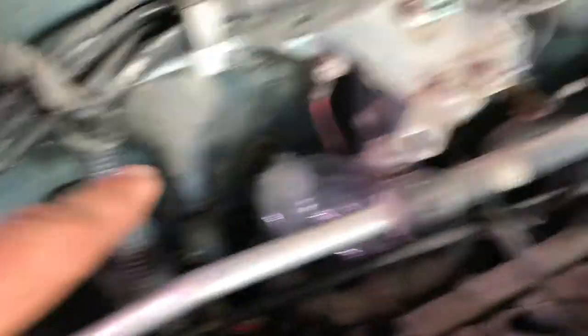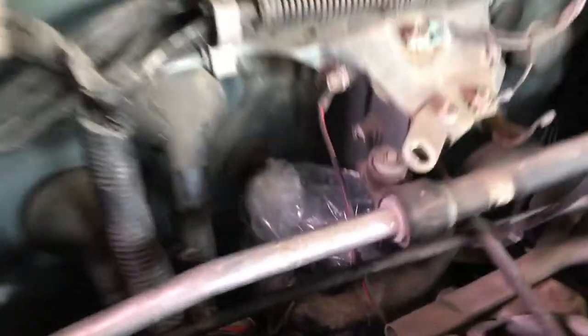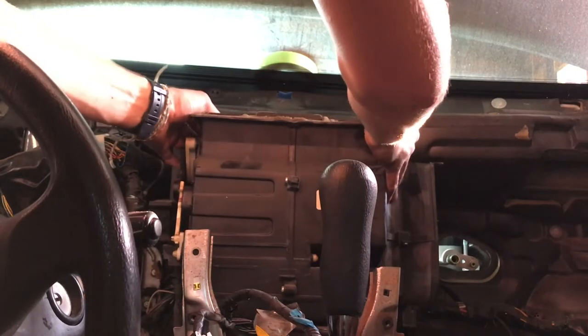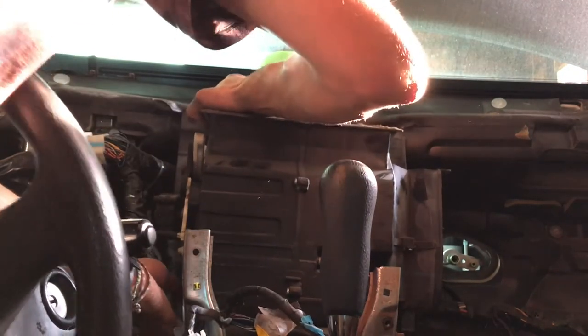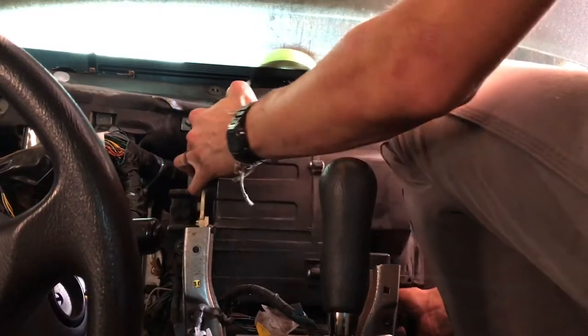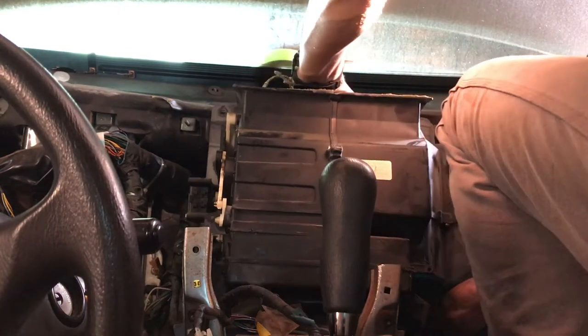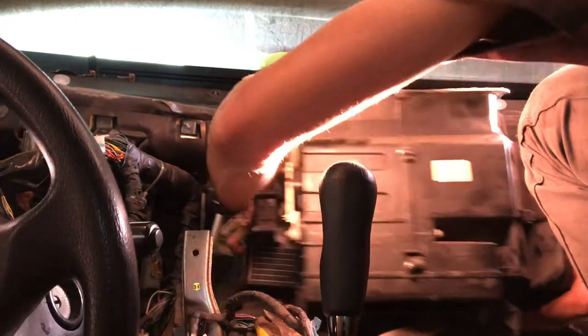AC box is gone — heck yeah! There she is in all its sunlight glory. We're almost done with this dash. I just tried to pull the heater box out and the two fittings were leaking coolant — I could hear it gurgling — so I stuffed them with some plastic I had laying around to hold it enough to get the box out and drain the coolant. I ended up bending and hammering the lower cutoff part of the crash bar to allow more room to remove the heater box. I'm feeling really good — I definitely took some steps today I've never done before, solving problems as I came upon them.